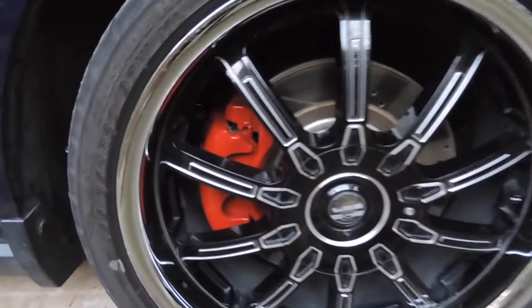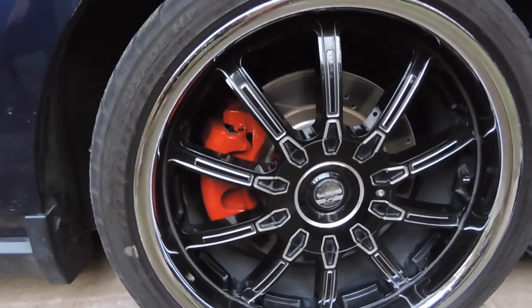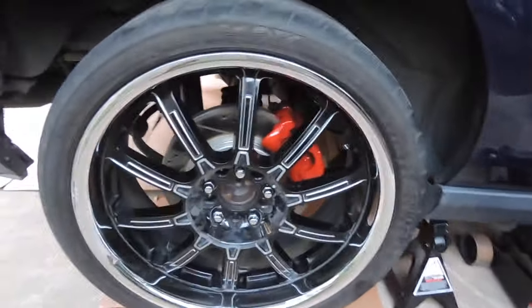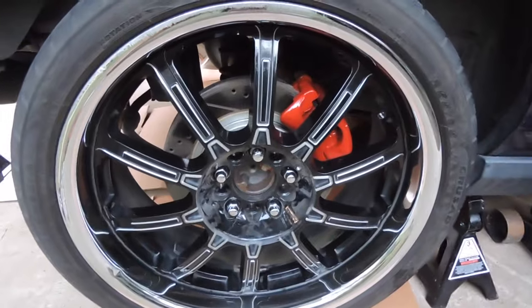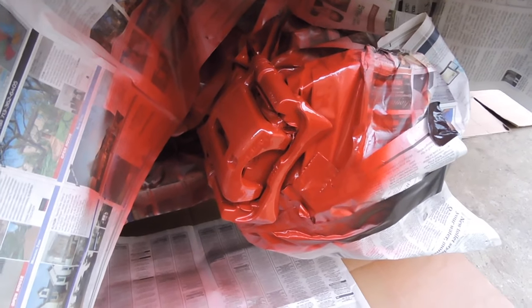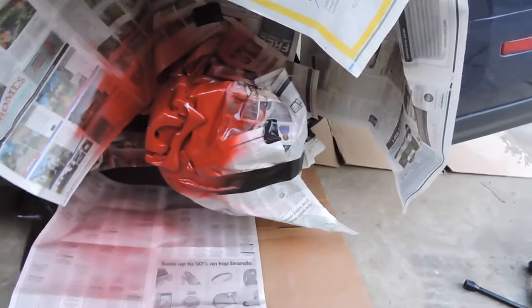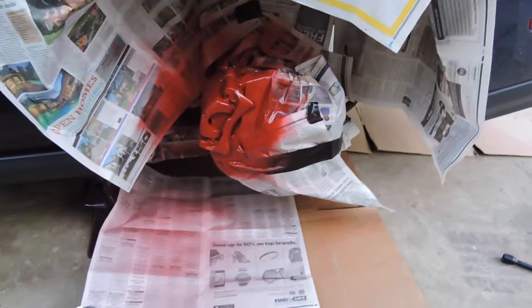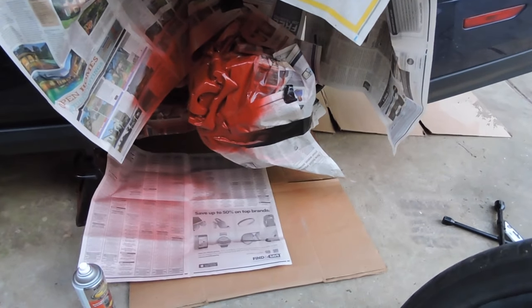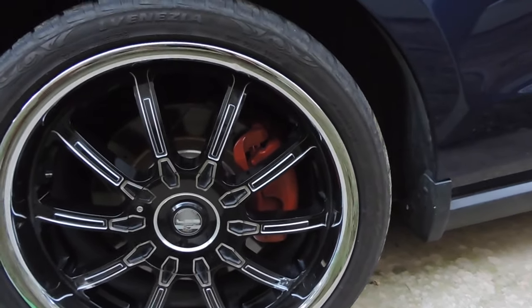Guys, I am done painting all my calipers. The front ones are already dry — I've been driving on them for two days and there's no chipping. There's that one tiny spot I need to fix; I'll do that in a couple weeks with some high-temperature automotive paint and a small paintbrush. The rear is still on the jack stands drying. One side's already been drying about an hour and I put the rim back on. The other side I sprayed about five minutes ago — it's already dry to the touch. I'll let it dry another 10 minutes. I'll be posting before-and-after pictures on Instagram.